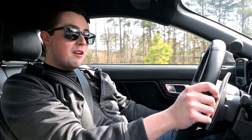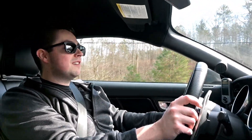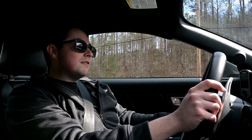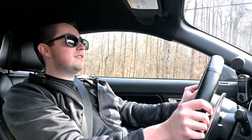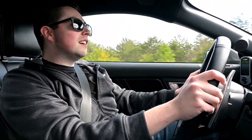We're driving now. First step is to get up to about 45 miles an hour and hit the brakes aggressively down to 10 — and there we go. I won't bore you with the entire break-in session, but I followed the instructions and thankfully everything went just fine. The calipers and pads stop this car so much better — honestly it's a night and day difference. I think you probably want to see how they look on the car so let me just show you that now.